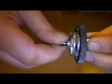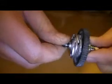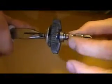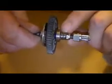Now, the pads on this slipper clutch look to be fine, but even though the pads look okay, in the spring I've only got this out maybe a quarter of a turn, maybe a half, and it still slips very easily. A lot easier than it should. So I have a feeling that the spring is actually the problem. The spring is probably weak. But I just got the whole rebuild kit, and I'm just going to rebuild the whole slipper clutch.